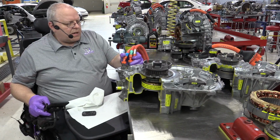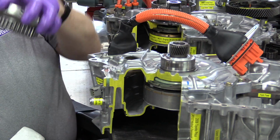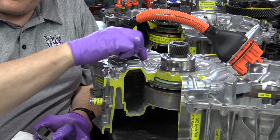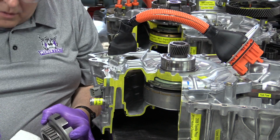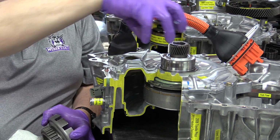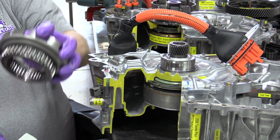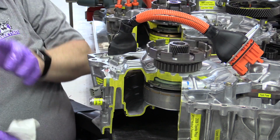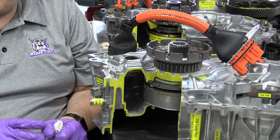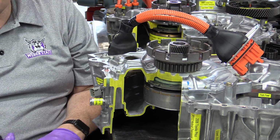The second generation Transaxle, the P112, notice that cast iron housing is gone and the bearing support is part of the aluminum housing, and what they have is a steel sleeve that's pressed on for the driven sprocket support bearing to rotate on. So that made it a little bit lighter weight.